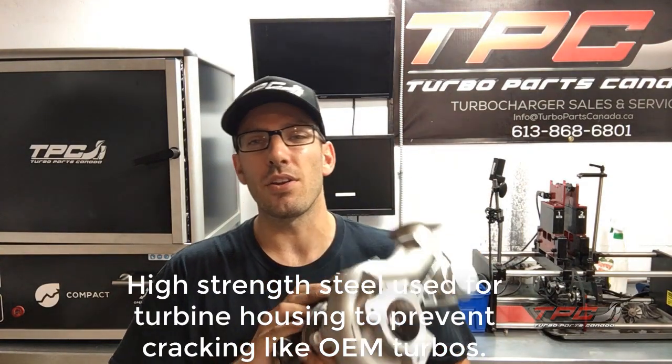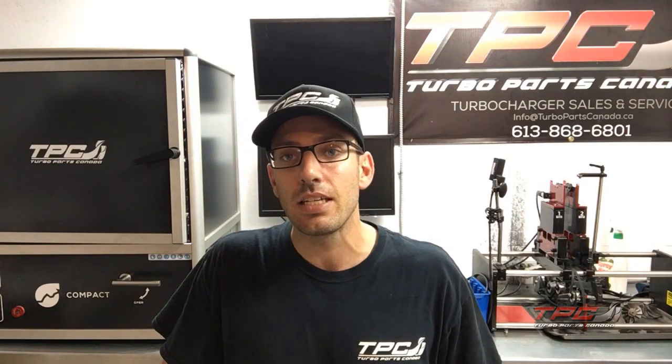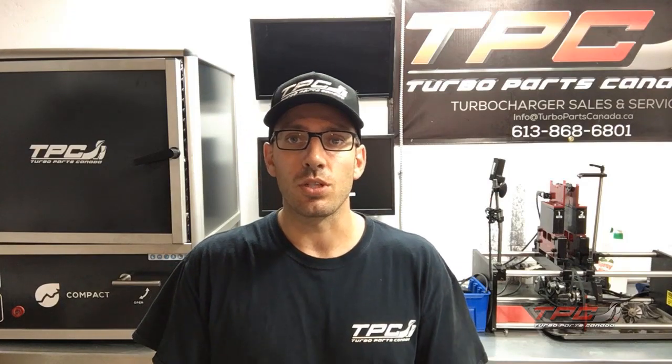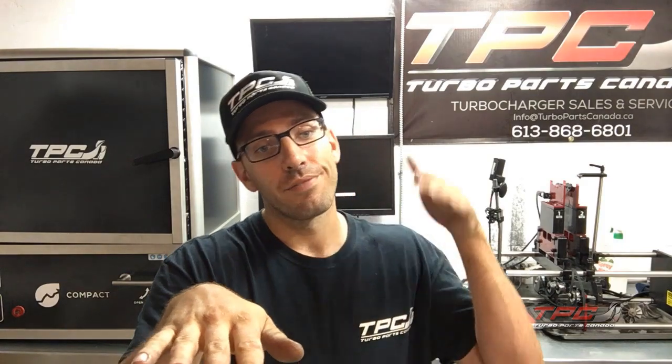It's the stock-size AR, so it retains that wicked spool. The Garrett units are 0.94 AR — you get top end but no streetability, it takes away all that low-end power. I'll post a video of AJ's car — he has a 3576 on C16 versus a red spec car on E85, stock engine, just a clutch change. Everything is bolt-on, looks like a super sleeper, and the usable power from that turbine housing spools better. By the time AJ's Garrett comes on C16, it's over — and that's a thousand dollar difference on a turbo right there.